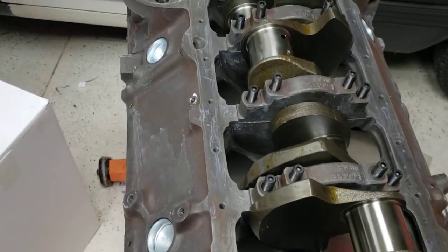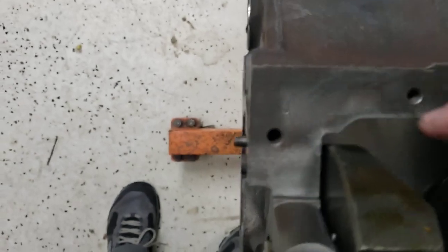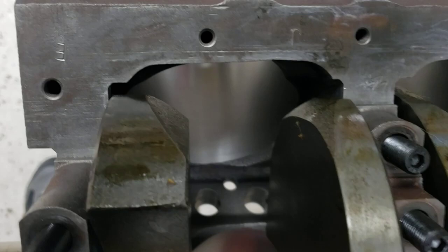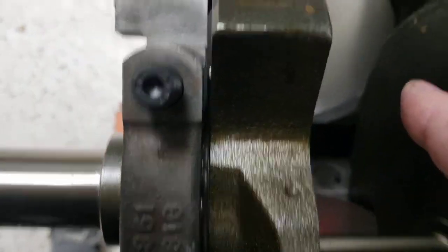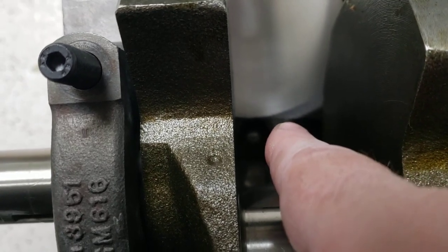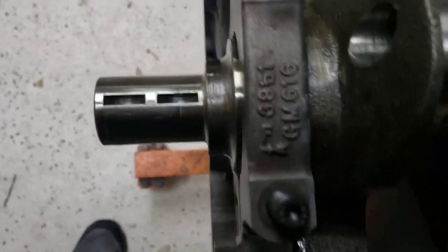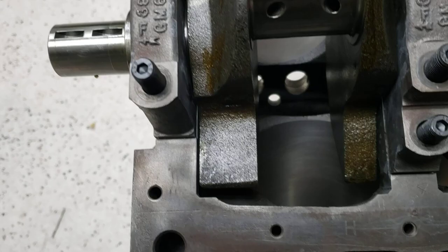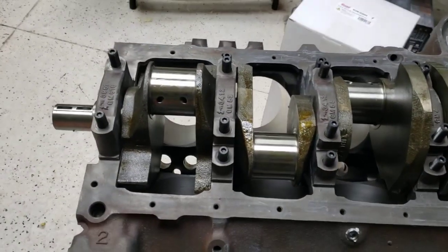In order to make a 350 block ready for it, it has to be clearanced for the size of the counterweight. So if you look here, you'll see that they've notched them out so that they fit without hitting anything. And then same down there in the piston hole, there's a little bit of clearance right there. Same thing applies here so that it can clear that area without any trouble. Same on this side — everything in the block is clearanced for the bigger stroke.